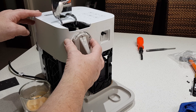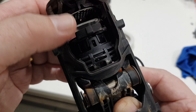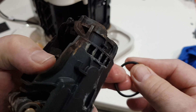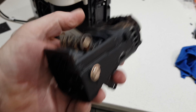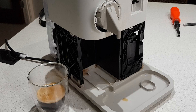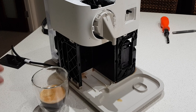So that was all there is to it. You need to put the cover back on with the screw, put the sides back on — they just clip on the same way they came off — slide the back panel on and the two screws, and it's finished. The old one was leaking around where the capsule sits. It has an O-ring in there and I had changed that last week but it didn't fix it. I couldn't see anything obviously wrong but it was just cheaper to buy a new infuser — $60 delivered, versus $600 for a new machine. It took about an hour. A couple of specialised tools, but nothing you can't pick up in the shops. If you have some success or problems doing this, leave a comment — I'm always happy to read them. Hope you enjoyed it and I'll see you next time for another Fix and Stuff with Dave.